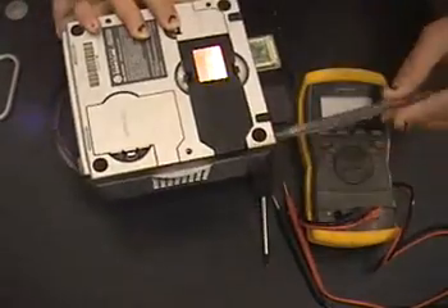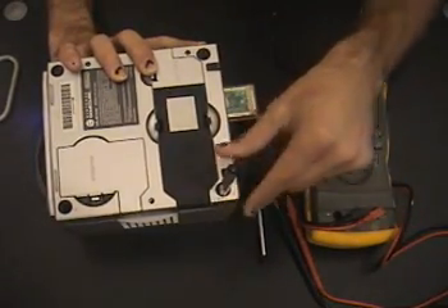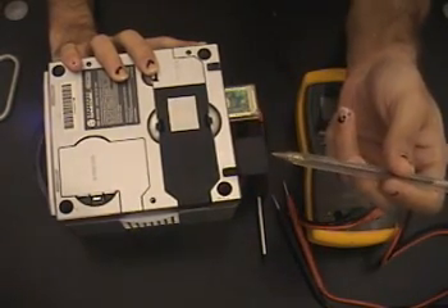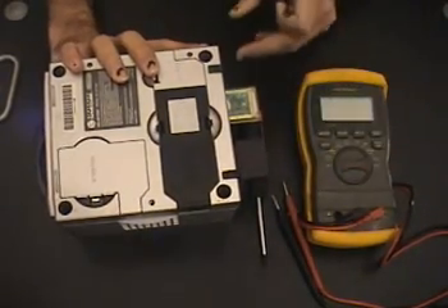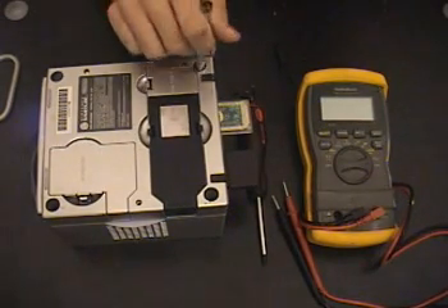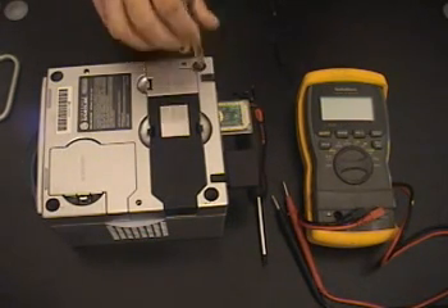Go into your cube while the pen tip is still hot and gooey, mash it all the way into the bottom and let it set. After a couple of seconds, the plastic will harden around the screw and you can use it to pull the screws out. You'll have to keep heating the pen up every single time you want to do a new screw. Don't let the pen heat up too much or catch fire, and try not to get molten plastic in the sides of the shaft — it's really hard to get it out.